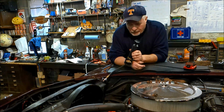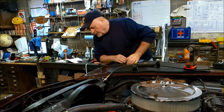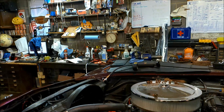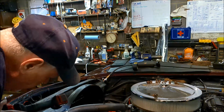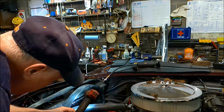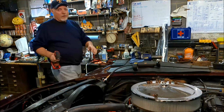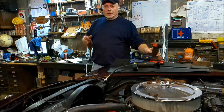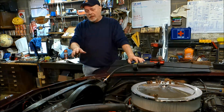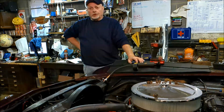It's not holding. Matter of fact, one... Two, three, maybe four. Oh me, yes. Definitely three leaks, possibly four. None of them in the section that they've repaired. One is where it connects up to the upper, I don't know what you want to call that, reservoir perhaps, the upper portion of the radiator.